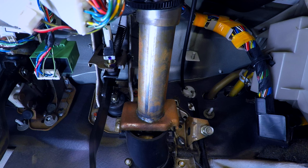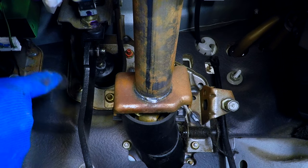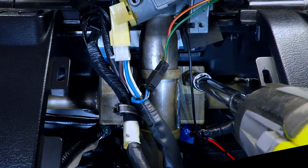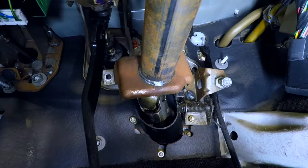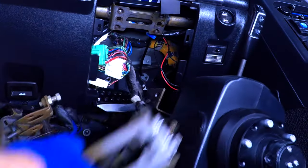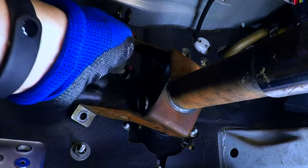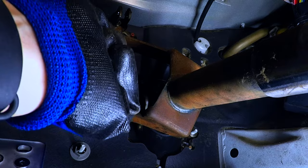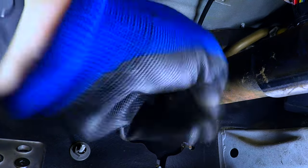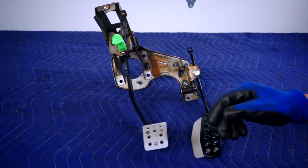Here we are inside the car in the driver's side footwell looking at the pedal bracket. We need to remove this bracket so that we can install the electronic throttle pedal. On the brake pedal, we need to remove the cotter pin as well as disconnect this plug. Let's unbolt this steering column bracket — there are two nuts on studs on either side. We've dropped the steering column by removing those two bolts. Now we can see that the bracket for the steering column is off of those studs. Pedal assembly out. Short of removing the steering column altogether, I found that rotating this bracket so that these arms are facing down was really helpful. That allows pulling the pedal assembly brackets forward and then rotating it around the steering column to extract it. And just like that, here's the stock Miata pedal assembly — brake and throttle removed from the car.